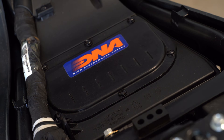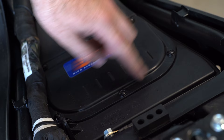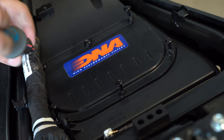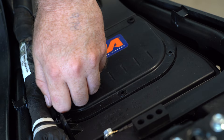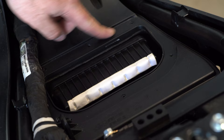And then we'll remove the airbox just under here - this is where we reveal the airbox. These bolts here are actually T25 bits, so that's just a star bit. You've got six of these bolts that hold the airbox lid down. I'm just going to get in here and take these off. Once we've got all these off, just want to take these screws out. And then the lid just pops off like that. There's your airbox lid there, which creates a seal around this lip here.